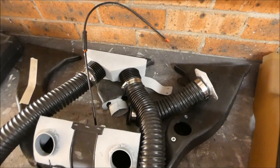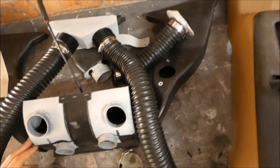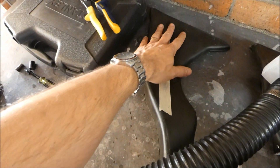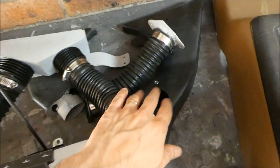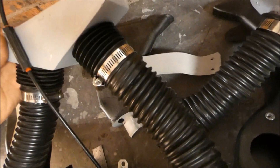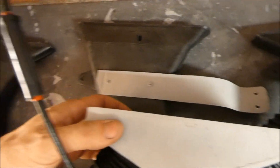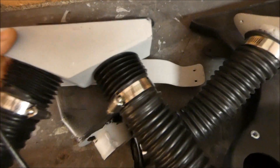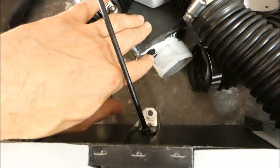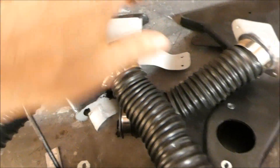So there's the whole system pulled out of the car. I've temporarily set it up on the bench to show you how it all works. These are the vents that feed the windscreen - the original ones from Ford. Underneath, there's a third one that I created with a bracket, mounting it with a new inlet made out of an aluminium flange. And here's the other one that feeds into that third vent - it'll branch off here.